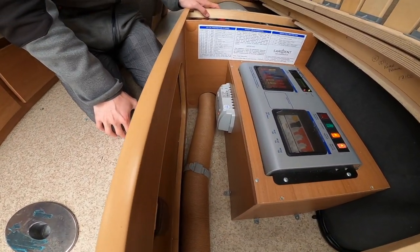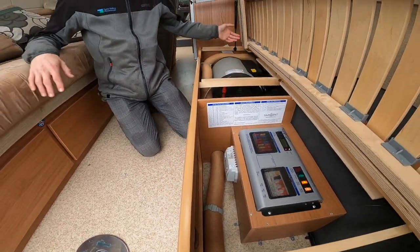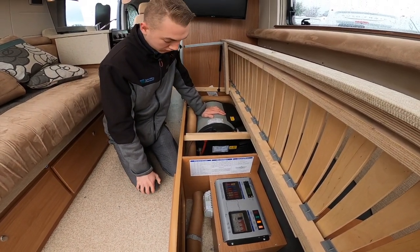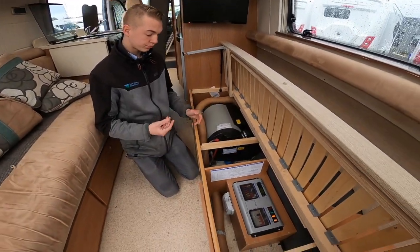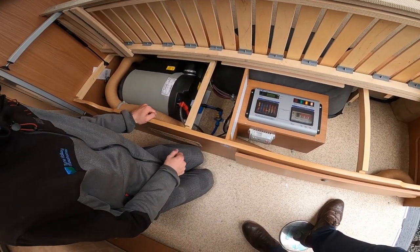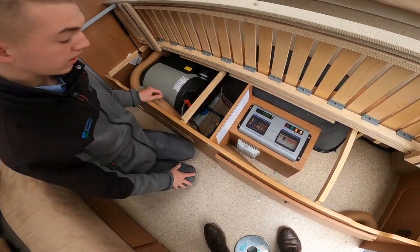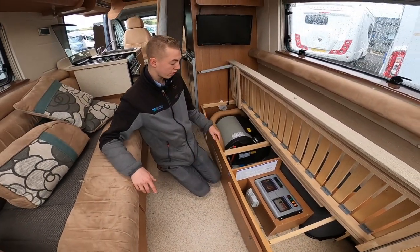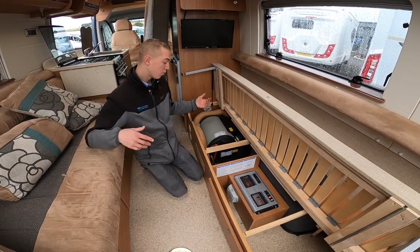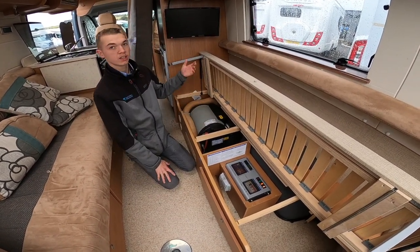On the front you've got your solar regulator which you don't need to do anything with — it's charging, but hook-up takes priority. You've got your boiler here which holds 10 litres of water at any one time. In the winter you don't want the 10 litres to freeze, so you would drain it off. To drain, just lift the toggle here and it'll push all the water directly underneath the chassis. Do this with no power on inside the vehicle, leave all the taps open within the van. When ready to use again: put it down, shut the taps, fill with water, go to the cold side of the tap first — you'll get automatically cold water — then go to the hot side, it'll cough and splutter as it pulls water from the main tank under the boiler and primes the system.